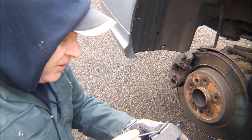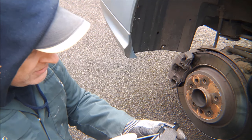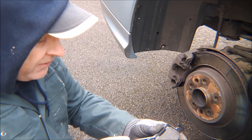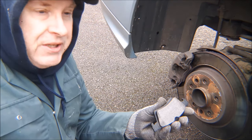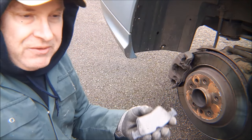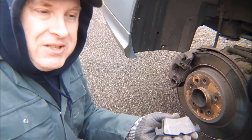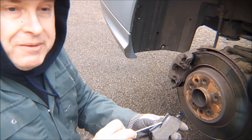The change in material composition happens gradually over the last couple of millimeters of brake pad material. The increased resin content and reduced metallic content means that the friction between the pad and the steel disc is reduced, giving you less braking available — which could be critical in an emergency. So that's the reason why you need to change your brake pads at three millimeters.